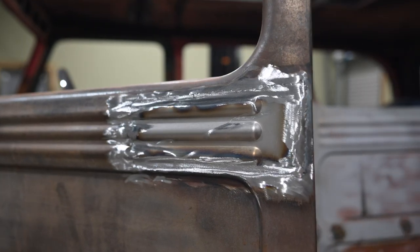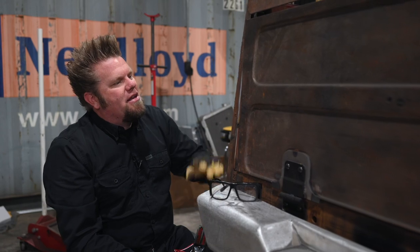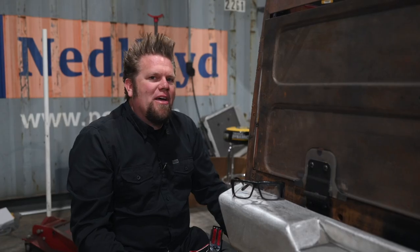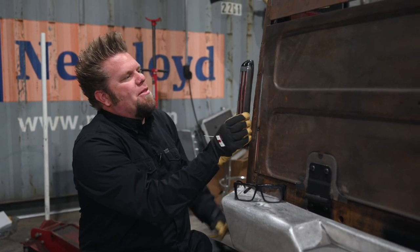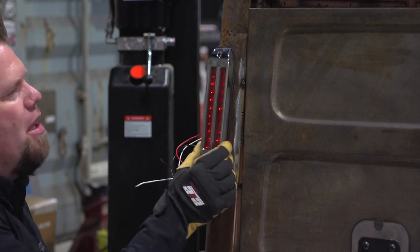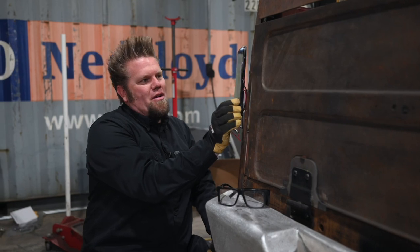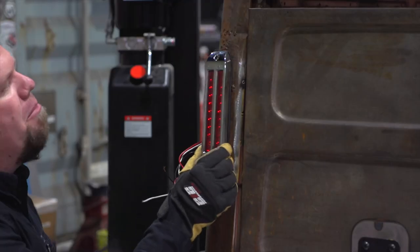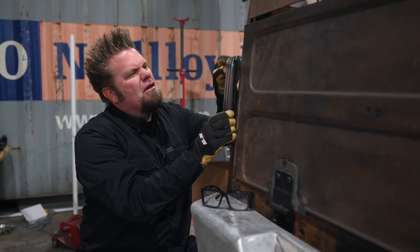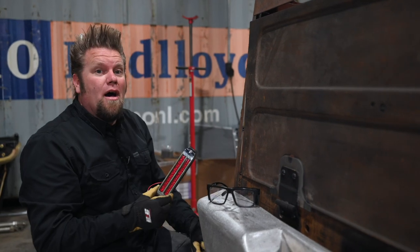From the factory, these Willys Wagons have a flush-mounted tail light with a little chrome bezel, and you can see the previous owner tried to repair it a bit. I don't want to run those tail lights — I want this to look a little different. I picked up these LED trailer lights online; they have a chrome bezel and I think they look cool. But I don't want to just mount it right to the sheet metal because there's a lot of metal to fix there and it would sit at an angle. So I'll build a little plate to step it off from the body and maybe do a little accent around the edge.